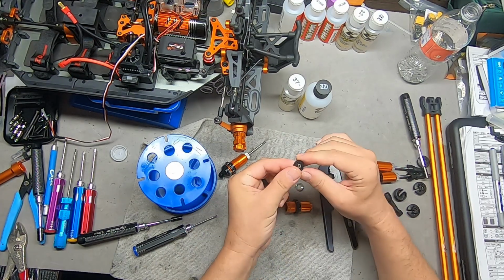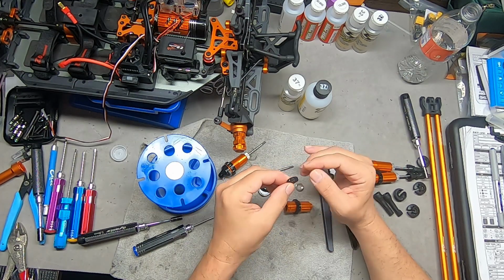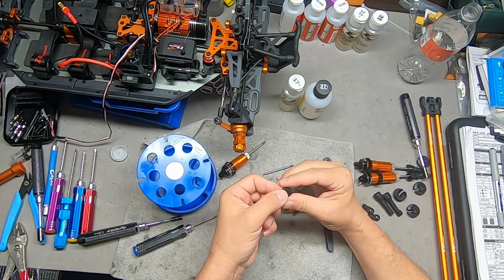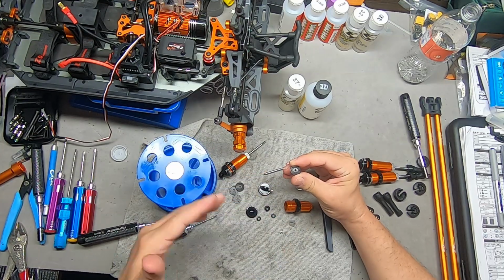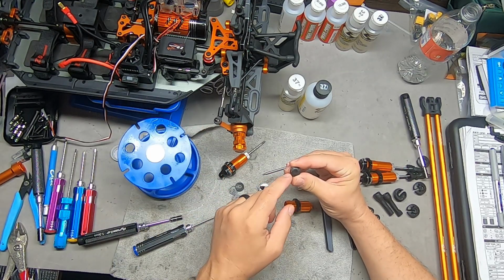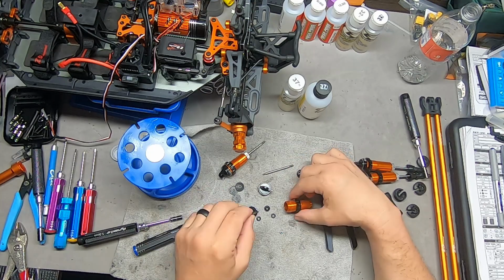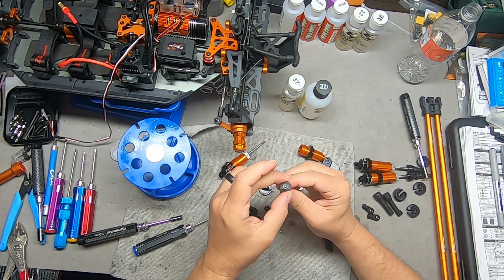First off, the pistons are a problem. They are really cheap, and I'm just not a fan for a variety of reasons. Fortunately, I have pistons that will fit. Now, I've only got one set of 4, so I don't have any choices as far as hole count and hole size, so I'll have to just go with this and hope the fluid works well with this piston. I may need to change the fluid later, but this is where I'm going to start. These are from a Kyosho Inferno MP10E, so in 1/8 scale buggy, and they are just the right size for our shock body, and they also have a hole that is the right size to fit our shock shaft.